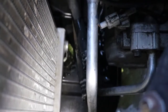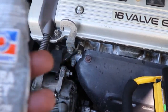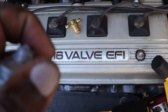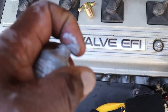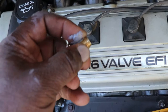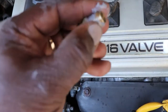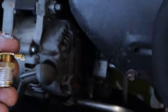And then we can put in the new valve. I put this gray ultra gray sealer on just about everything, and I'm going to put that on the threads of this valve too. One-handed — see if I can do this one-handed. I just don't want it leaking. I want to put a little seal in those threads so they don't get any leaks down the road. That way you don't have to tighten it real tight — you get it on there and it will seal very, very well. A little bit of sealant on the threads will help it seal very well.